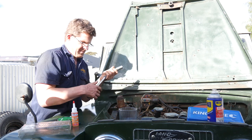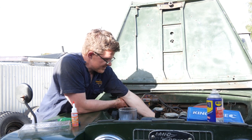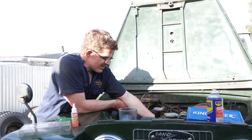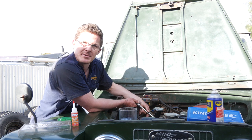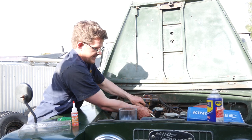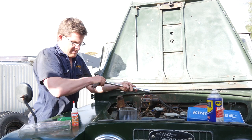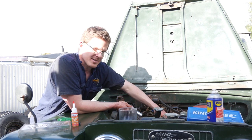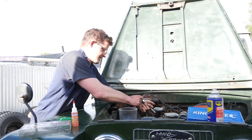When pulling spark plugs, you really want them to look almost a little bit rusty on the end — no oil. They might be slightly black, but that's okay. It depends on what kind of driving you're doing. If you're just doing short runs to the shop and back, the car's never really going to get up to temperature. Particularly if you're using a more mature vehicle, it's really good to take it for a good solid run. It just blows all the gunk out the back, and puts it all over the Honda Prius behind it, probably.